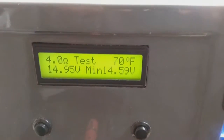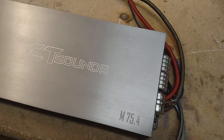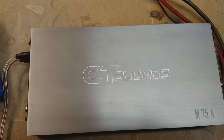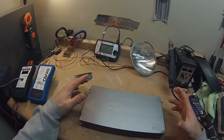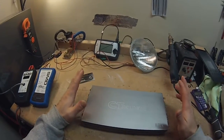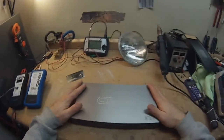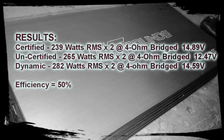Dynamic run: 282 watts at 14.59 volts — pretty impressive out of this little tiny amp. That's almost 300 watts per side, or about 150 watts per channel, which would be at a 2-ohm load per channel. At 4 ohms figure a little less than that, but still pretty good considering the size of this thing. Thanks for watching — check out my Facebook page, link in the description, and make sure to check out my Patreon page too. It really helps with upgrading my dyno setup. Thanks a lot, make sure you rate and subscribe and I'll be back with more videos.